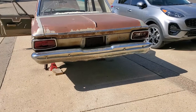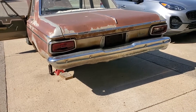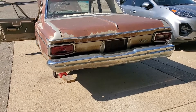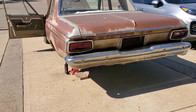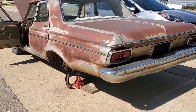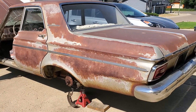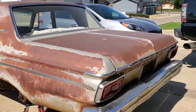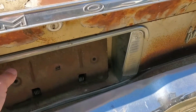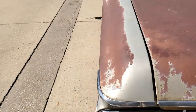One of the first things I've done since the last video — we crawled underneath and pulled the fuel tank out. It had a couple dents in it and a great big piece of canvas strapped underneath, because obviously this thing was used for chasing through the pastures chasing cows at one time. Rinsed it out, there was just a little bit of old fuel left in it, and actually the inside of the tank was really good — no rust or nothing. So we replaced the fuel tank, put new rubber fuel line on in the back, and managed to find a gas lid, so the fuel tank's good.